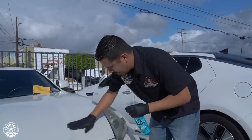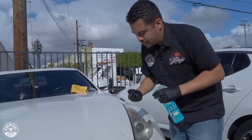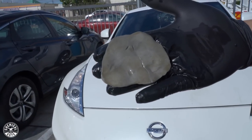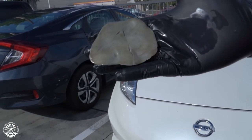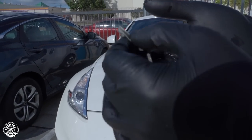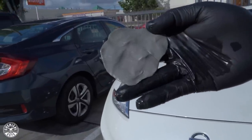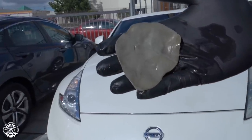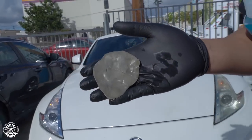All right, guys, so as I'm getting prepared to wrap up this panel, I'm gonna go ahead and pick up my clay bar. Check this out. I'm not sure if it catches it on camera, but the clay bar will have some patches of brown. I'll flip this clay bar around. You see this right here? This is how it was before we started claying the surface. You see the gray clay bar is a lot lighter compared to this. You have more of a brown, yellowish film that looks very nasty, and that's all the contamination that you're pulling